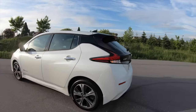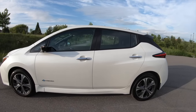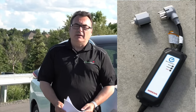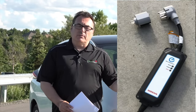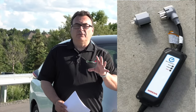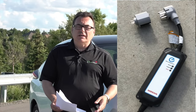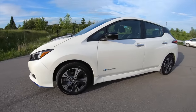One thing Nissan provides with their vehicles is a portable charge cord — but theirs is a 120 and 240 volt EVSE. So you actually get a Level 1 and Level 2 cord with it, because it has an adapter for a 110/120 household plug here in North America, and also a plug for a dryer-type outlet so you can pull more amps. This saves some people from having to buy a separate Level 2 wall charger.